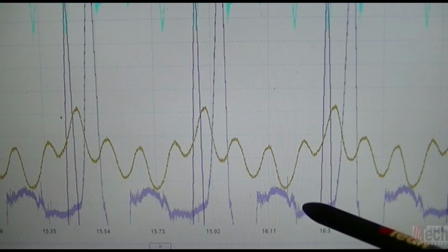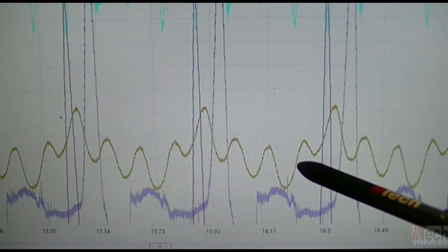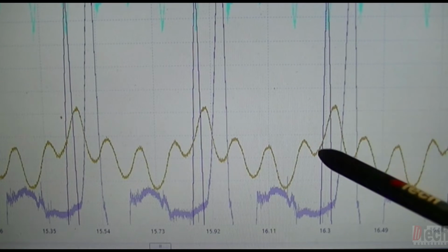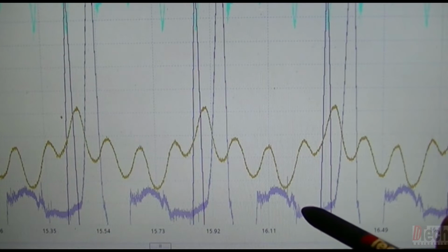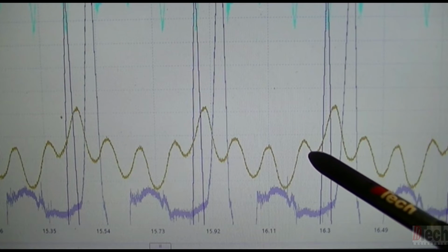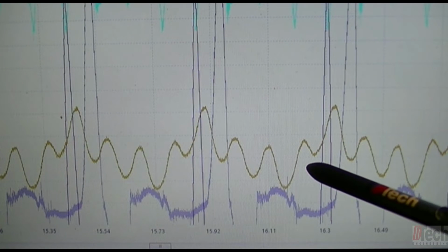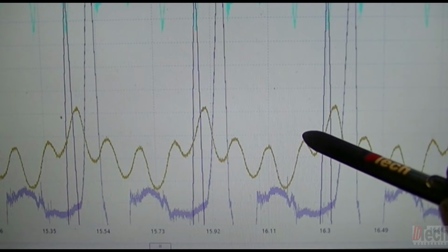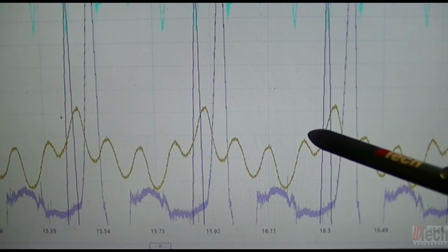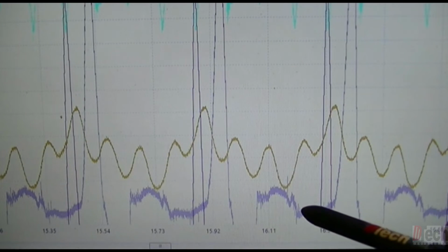Now, this is what's going on here. We can tell because this pressure rise in level is occurring during the intake stroke of the bad cylinder with the hole in the exhaust valve. So basically what is going on is the piston for cylinder 3 is going down during the intake stroke, and since we have a leak through the exhaust valve, it cannot have a strong pull. We lose strong vacuum in the cylinder, which then is a weaker vacuum in the intake manifold, and it loses kind of the battle, and higher pressure starts to take over because the pull isn't as strong. So the level rises, and it rises all due to a leak on the exhaust valve during the intake stroke.